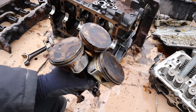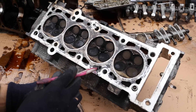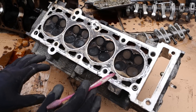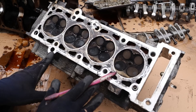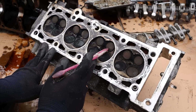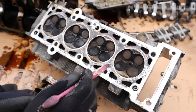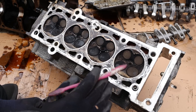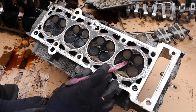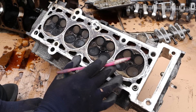This engine was just worn out at 260,000 kilometers. Taking a look at the engine head, you can see the issue is very similar — look at how much carbon is built up in these little cavities. The head itself appears to be in good condition. One of the most common issues with these Mini Cooper engines is low compression, which is what the previous owner complained about. Typically one of these valves would burn out and that would cause the compression between the piston and the cylinder head to just push right through the exhaust port. Once you've completed a dry compression test, the best thing to do would be a leak down test where you push compressed air down into the cylinder and you'd hear it squirting out the exhaust or intake side.